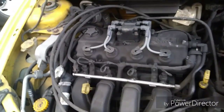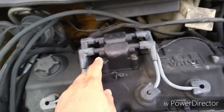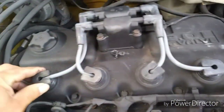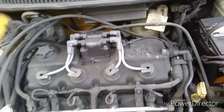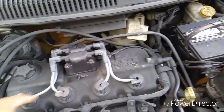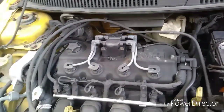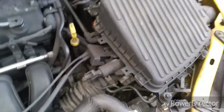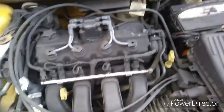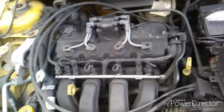After a quick search on the internet — the coil pack bolts are 11.5 foot-pounds, so 11 to 12 pounds of torque is okay. For the spark plugs, 13 foot-pounds is your magic number. You can go by the torque spec or hand tight with a quarter turn after. Just make sure you put anti-seize on it. My next job will be the cold air intake — it's kind of sloppy — and then all four motor mounts. eBay is the way to go for parts. Like and subscribe, guys — I appreciate it.